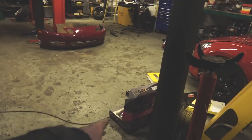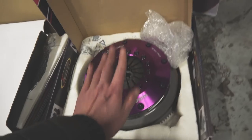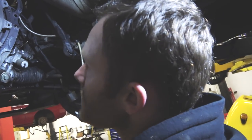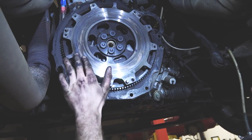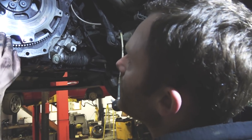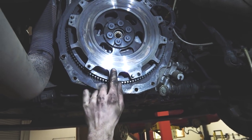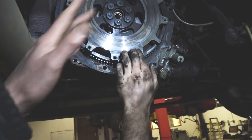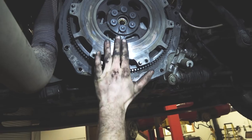So we are going for that shiny purple number down there. This is stage seven - cost about 24,000 credits. So this flywheel can be skimmed - it's got some light grooving where you can see the rivets are starting to touch. But we can send this to a machine shop and actually get them to skim it, give it a completely flat face again - take a layer off it - and then it could actually be reused.